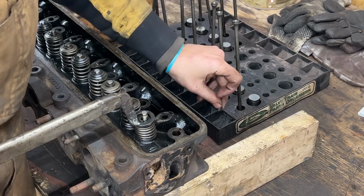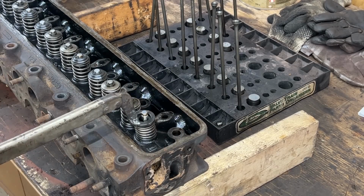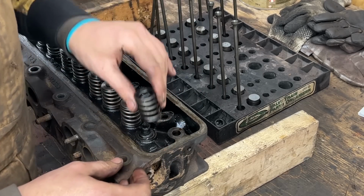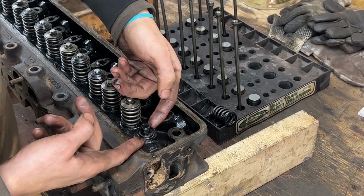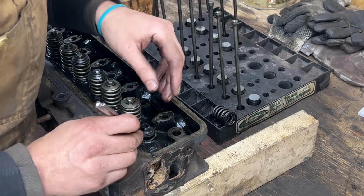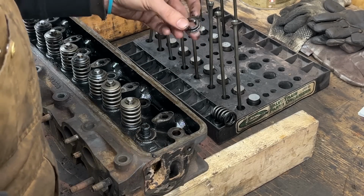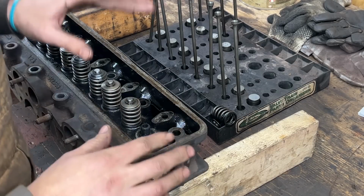So take out this. The exhaust valves have a double collar on the top. I have a single spring here, and the collar on the bottom, which I can't take out. And this collar at the bottom, there's no spacer or anything. As you know, Triumph never used valve seals, so we don't have a seal here.